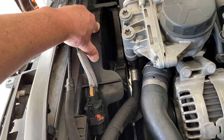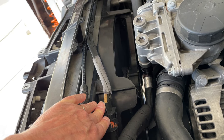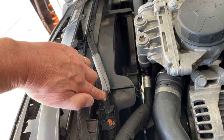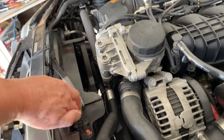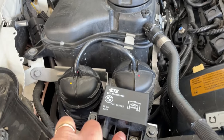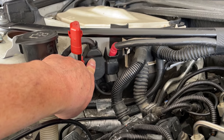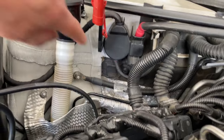Here's the 850 watt fan installed with a new connector. This connector has number eight wire coming off of it — significantly larger. The positive terminal goes over to the relay, and the other side of the relay goes straight to the lug for the positive 12 volts. The negative is just below it.